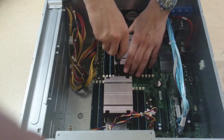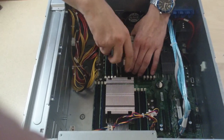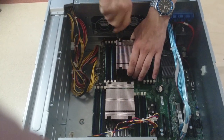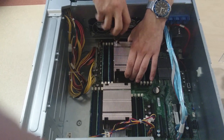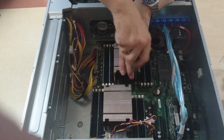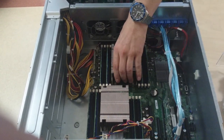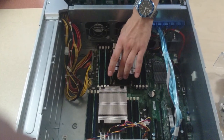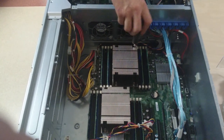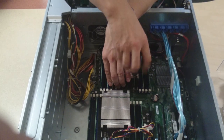In the cross pattern, always make sure you can see the heat sink and watch the screw and the screwdriver. That's the second screw loose. Now let's go to the third and fourth screw. You should probably see it's already coming around. If the heat sink is coming off on one side but doesn't lift off completely, you must have one screw still intact somewhere — make sure you find which one is not fully loosened.